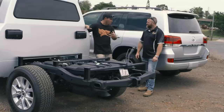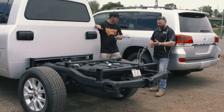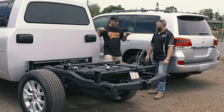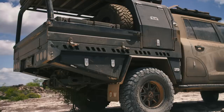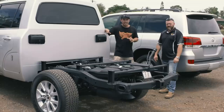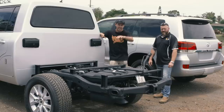It's going to ride a lot better and also carry that weight so much better. DMW does a range of chassis extension sizes — 300, 400, 650 and 750mm, and they can do in between as well. Some customers choose no chassis extension, but that's quite rare. Ruben personally runs 750mm in his, which gives him an extra long tray and toolboxes for extra storage in front of the wheel. The tip is: whether you've got a 79 series, a D-Max, or any ute, try to get that weight distribution just right. Get the rear axle in a position to carry that weight and it's going to ride and perform so much better.